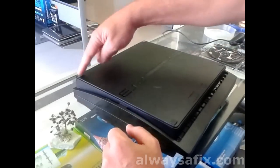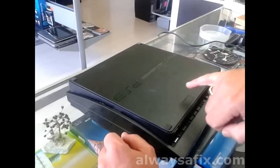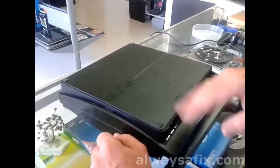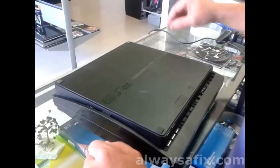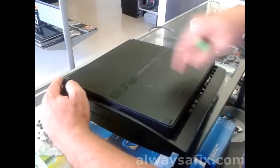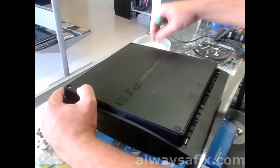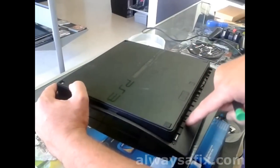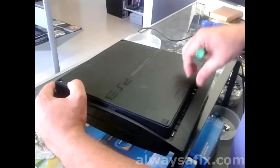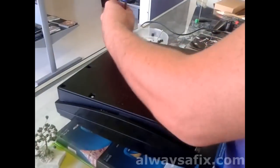So you remove some covers here. You remove these covers except for the one in the left bottom corner — the longer one, which is the cover for the hard drive. There's no need for the hard drive to come out. In the front there are three Torx screws. These are the Sony security screws. Just find a flat screwdriver that can sort of fit in.